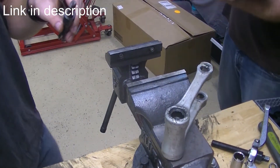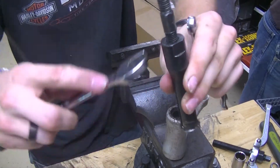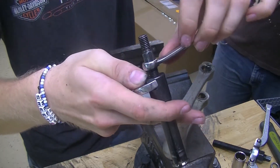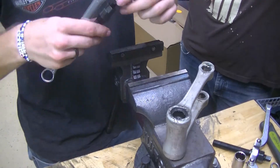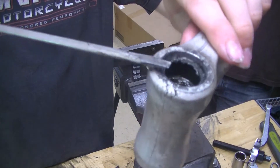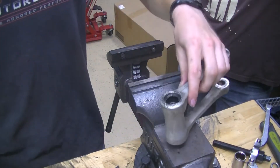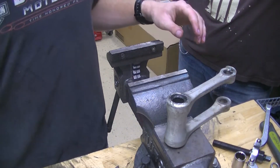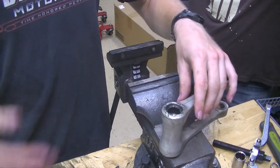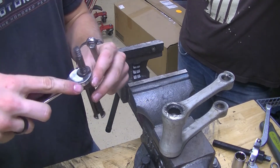I have a wrench on this section here and then a 10mm on top, and I'm expanding it to fit into the top race right there in the bearing — because you don't want to do the back race since that's the one pushed up against the intersection. You don't want to scar the inside because the sleeve still has to go all the way through, and if you scar it, it'll catch and potentially be damaged. Damaged suspension is not easy to replace or cheap.